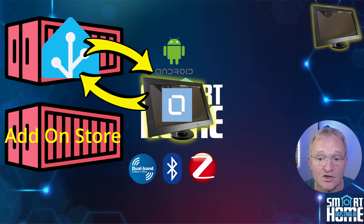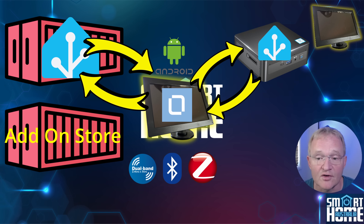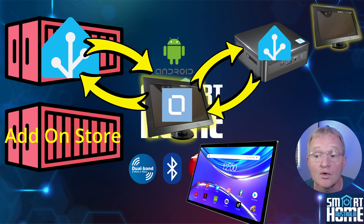There are two extra party tricks that the ISG Max can do. Firstly, if you don't want to run the local version of Home Assistant then you can also link the ISG to a remote Home Assistant instance, which we demonstrated in the first video. This is super handy in case you outgrow the hardware of the ISG and want to move to a NUC or VM version of Home Assistant that's more powerful to meet your needs. And finally, if you're running an ISG Max and have an Android tablet in your home, you can run the ISG Lite application that syncs with the ISG Max, so you get all the functionality and connectivity on any Android tablet connected to your network.